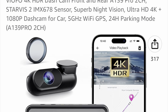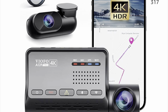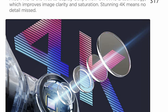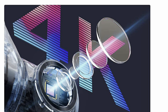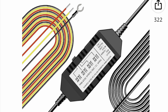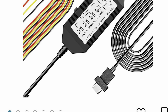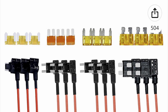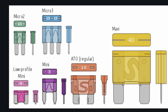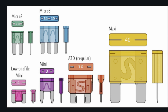After doing much research on the endless amount of dash cam options out there, I ended up going with the Viofo A139 Pro. This is the two-channel one with front and rear camera. It has the new Sony 4K Starvis 2 sensor, which makes a big difference in low-light performance — getting the tags and license plates at night without your headlights blowing out the image. The hardwire kit I also found on Amazon is specifically for the Viofo and includes the USB-C power cable along with a voltage adjuster you can set to your liking. Also grab some fuse tap adapters — for the Hyundai Palisade, it uses a Micro 2 fuse, so that's the one we'll be using.